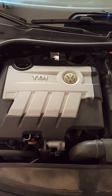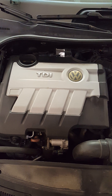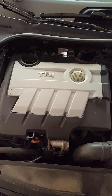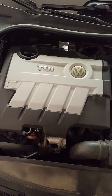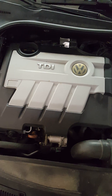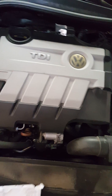Hey, what's up guys. I wasn't really finding a video on this so I figured I'd make one for you as I'm going along, in case anybody else out there has the same problem. This is for P047A, a code I was getting on my car. This is a 2009 Volkswagen Jetta TDI — that's the exhaust pressure sensor B circuit. I did a little bit of research and found out the culprit.